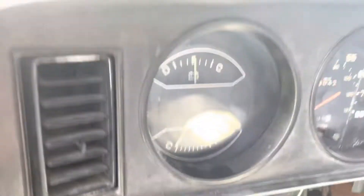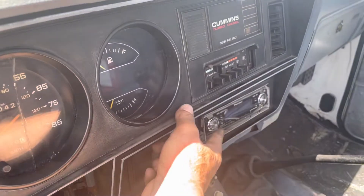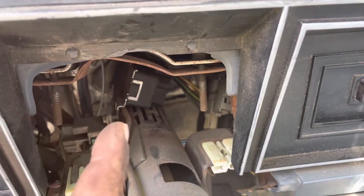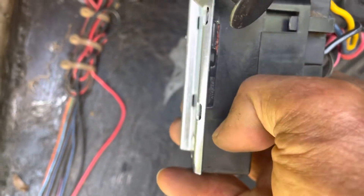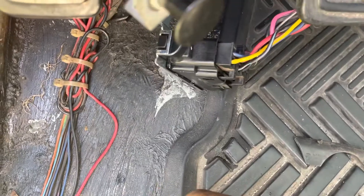If you're having problems where you lose power to your gauges, your AC head unit, and your radio, most likely it's that problem right there. There's a shaft that goes to it under it. Here's the new one hooked up — goes right up in there, and it's a simple switch that goes back and forth with the key. It turns the power off and on, and I was having problems with that.